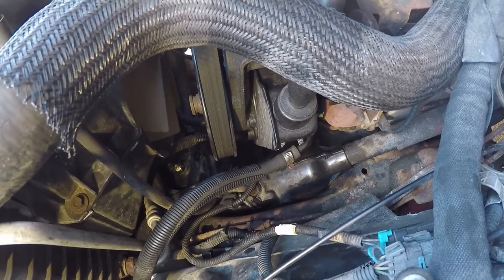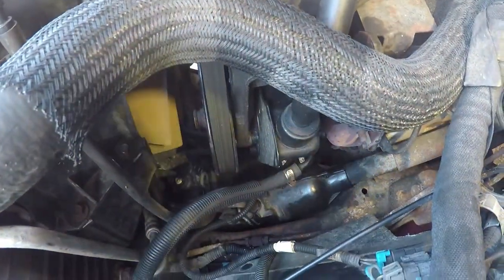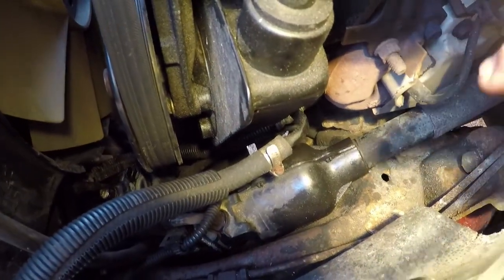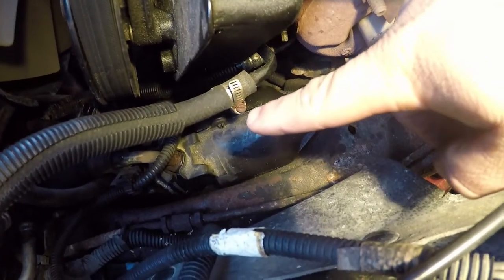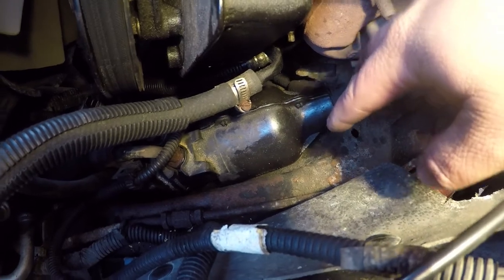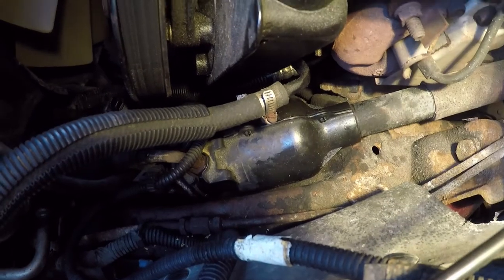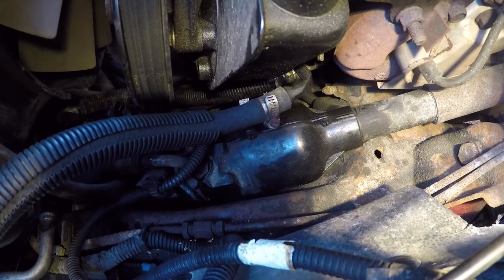First off, I want to apologize — it hasn't been windy today and it's starting to get windy and freaking cold too. But anyway, let me get down in there for you so you can see. Right here there's a little plastic cover — get a pair of needle nose pliers, there are two little clips that go through the other side, you just pinch those and push it through. You can get your plastic off — it hooks to the one power steering line right there and it'll give you access to the coupler so we can unbolt that and remove it.